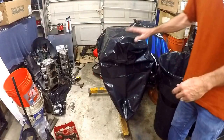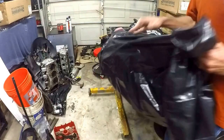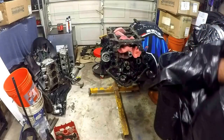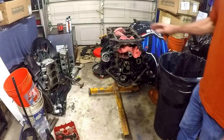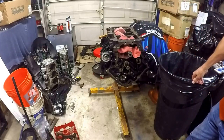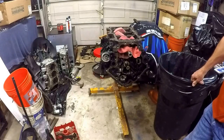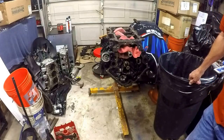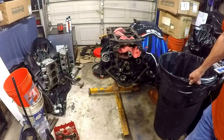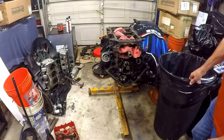I've got the motor here — the block and the bed plate with the spray. They've been reworked and brought back from the machine shop, and they look real good. We managed to clean up the number five cylinder and it looks great. There's a little bit of pitting at the very bottom, but that pitting area has been smoothed. Everything looks good and it's all below the second compression ring, so we should be really good.